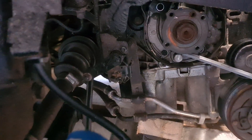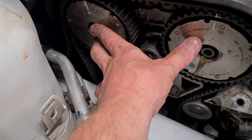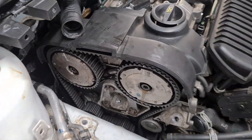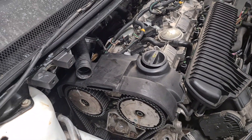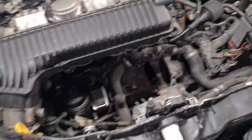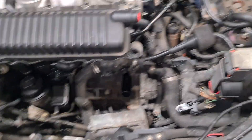I'm going to tension up the tensioner now — it's a little dark under there. Once that's tensioned, that'll bring everything into line, then I tighten up these bolts. Once that's done, the engine is timed at zero and then it's just a case of putting everything back together, remembering to remove the crankshaft locking tool.